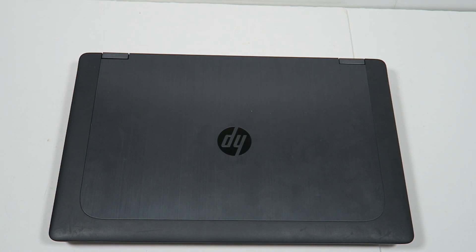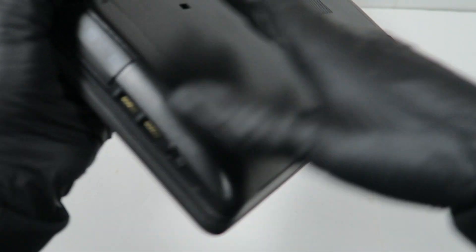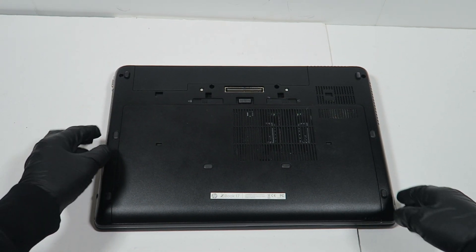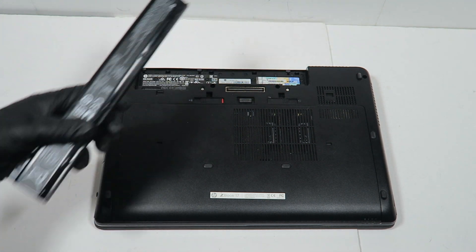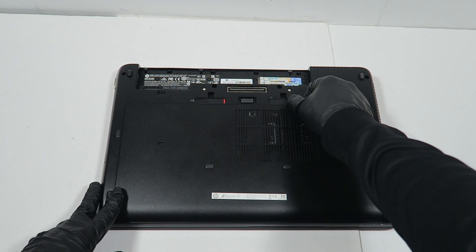What's going on guys, this is a Mexican here — another HP ZBook, this is the 17. I'm going to show you some upgrades. I'll switch to the other backside. First I'll remove the battery — you press on the left right here and it'll come out. The back cover you're also going to press on it.